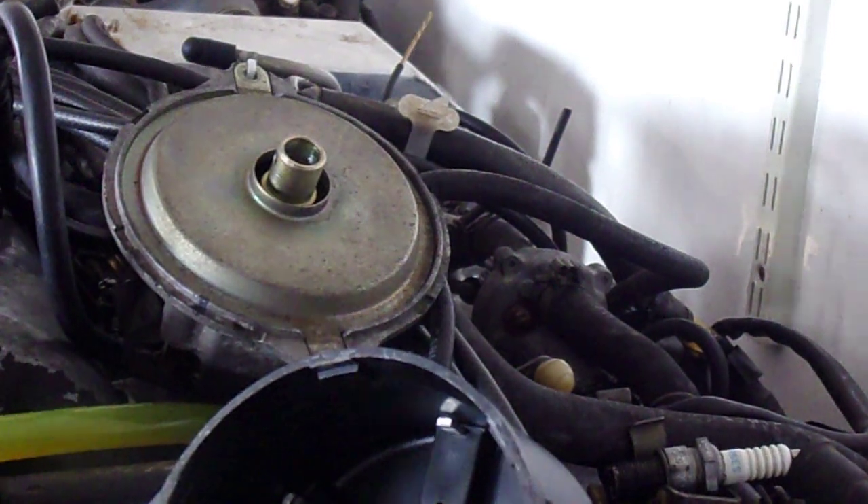I've put a test light down there. We'll go ahead and do this - that's the normal five-second turn-on. There it goes, and that will come on. I'm going to rotate the distributor. You'll see the pump works because this should come on. There's an interesting sound there - I think that's coming from the vacuum actuator over there, probably the idle control air thing.